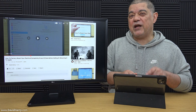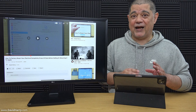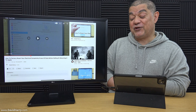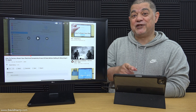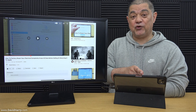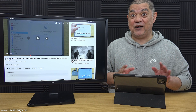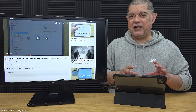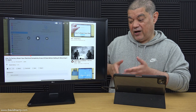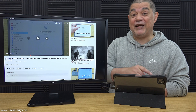What happened was when I went to press play, the screen or video area in the app went black, and it did so on the monitor here as well. I've just worked out what causes that. What you should do is launch the app after you've connected the cable — I've just exited the app and gone back in again, and it's all fine now. I think a lot of things that use video playback need to be launched after you've set the cable up, and that's exactly what I've done now and this is working properly.